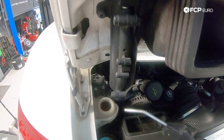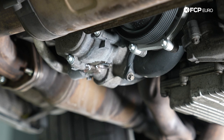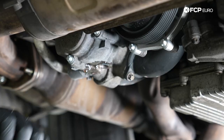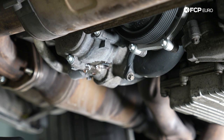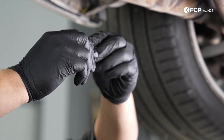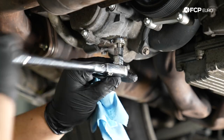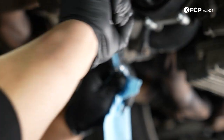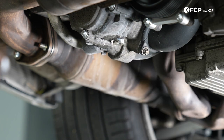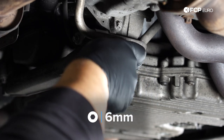I'm putting my shop air nozzle into the expansion tank and covering the rest with a towel — you should be able to see coolant flowing down below. Once that's done, we're going to reinstall the drain plug on the thermostat side. We have a new crush washer for this — always replace the crush washers when doing this job, just like an oil drain plug, it'll leak if you don't. Snug it up by hand with the 3/8 ratchet, then torque it to 30 Newton meters — don't gorilla it, just be gentle. We'll repeat the exact same process on the water pump neck side, including the air purge, and install a new crush washer there as well.